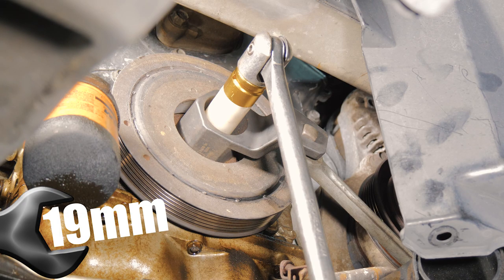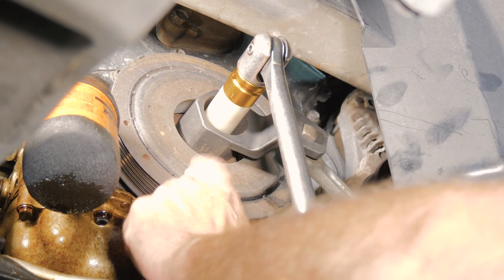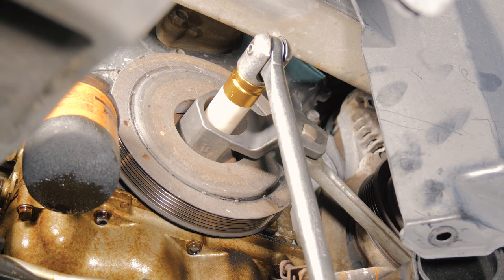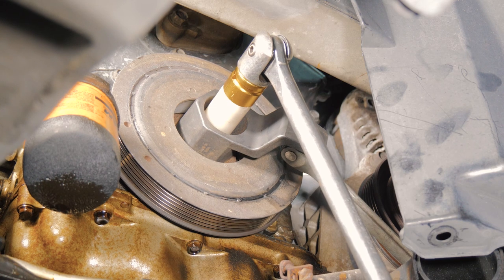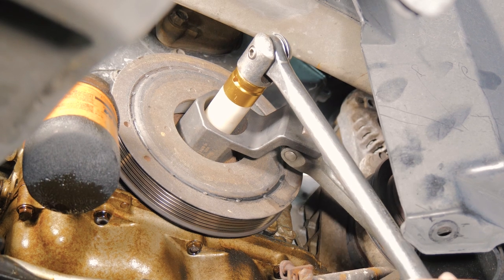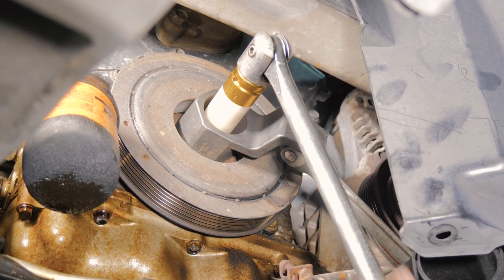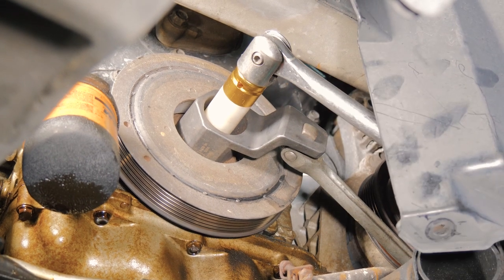All right, so we tried the air, and it didn't work. I have the crank pulley with the tool bound up against the frame right here and a bungee tie around it so it doesn't move. And I have a breaker bar with the end of the hydraulic floor jack here, to try to get a lot more leverage on it. All right.